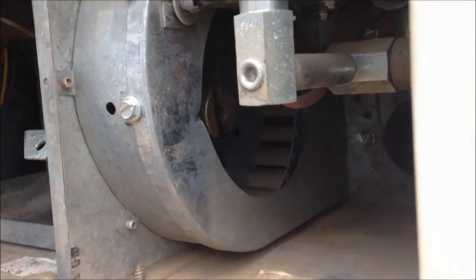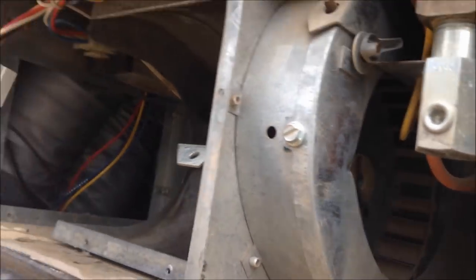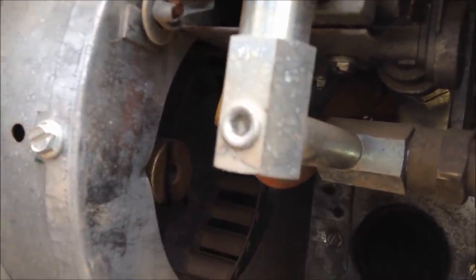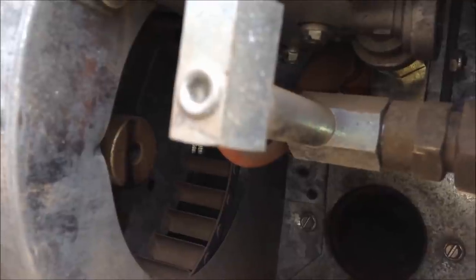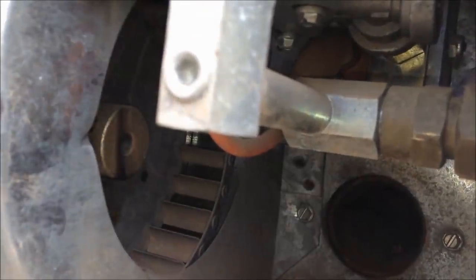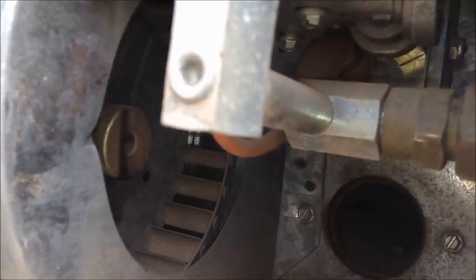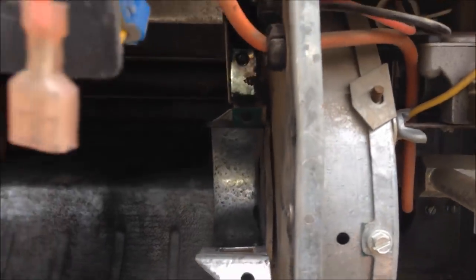I got it — that was an adventure. What I had to do was hold a wooden match on the center hub of that fan for 30 seconds to a minute — just held it as long as I could before it burnt my fingers — to heat up the outside part of the hub. Then I took a screwdriver on this side between the motor and the plate, pried it, and boom — it popped right out. So here's the motor.